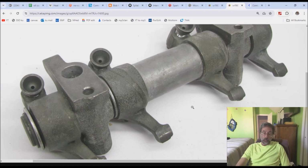You don't want to put the ports like this one right here. This, of course, would be the intake. You don't want to do that. No poking oil at the intake, because it's going to just get sucked down into your guide and you're going to burn the oil. Intake guide doesn't need to be cooled. It's only for the exhaust. How you get that aligned, that's up to you. For a car, I wouldn't do it on a car, maybe on a bus. You airplane guys, perhaps. Spot cooling, does it work?